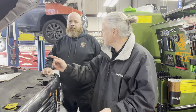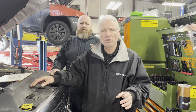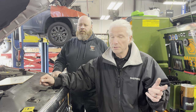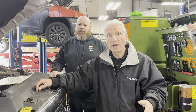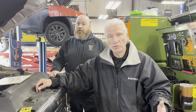The Hemi — I believe it's very low mileage, like 30,000 miles on these. So make sure you're looking up the spec on these things too, because sometimes you'll feel like we always heard about the 100,000 mile spark plugs or 120,000 miles, but there are a lot of vehicles that are much, much lower than that. So make sure you're looking that up in the maintenance schedule so that you're doing the spark plugs at the right time.